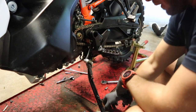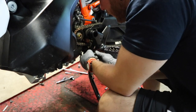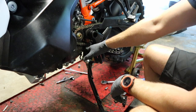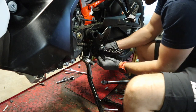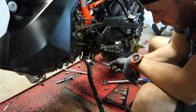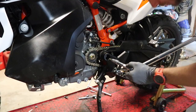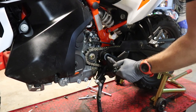With the side stand bolt in, I don't want to tighten anything down yet because I need a little wiggle room for the larger bolt that goes through your rear stay and then into the side stand and into the frame. Get all this lined up, then torque this down to 45 newton meters, then come back up and hit your side stand bolt at 45 newton meters — 33 foot pounds. Put the spacer in behind, get the bolt going through the stay into the side stand, tighten with fingers, then torque everything down to 45 newton meters. Don't forget the swing arm bolt — torque it down to 100 newton meters using the T50.